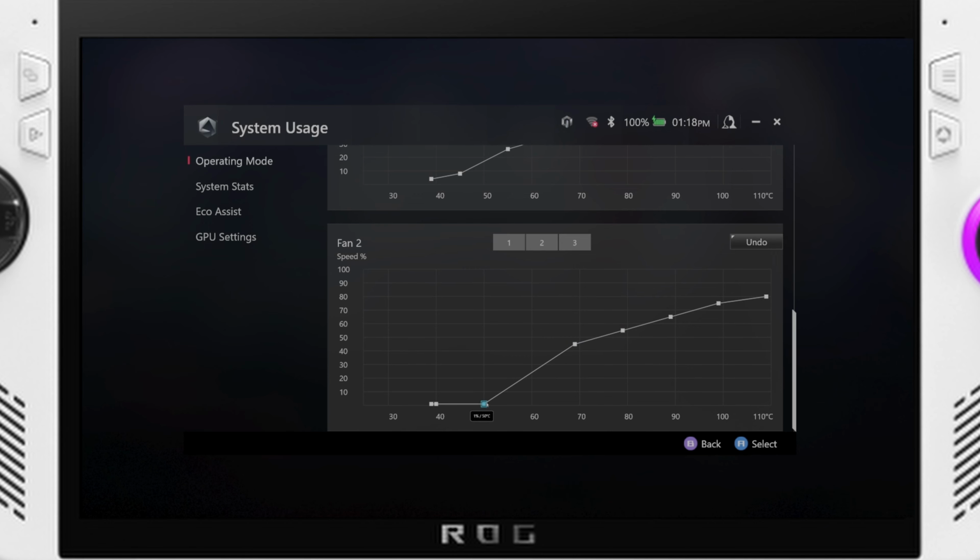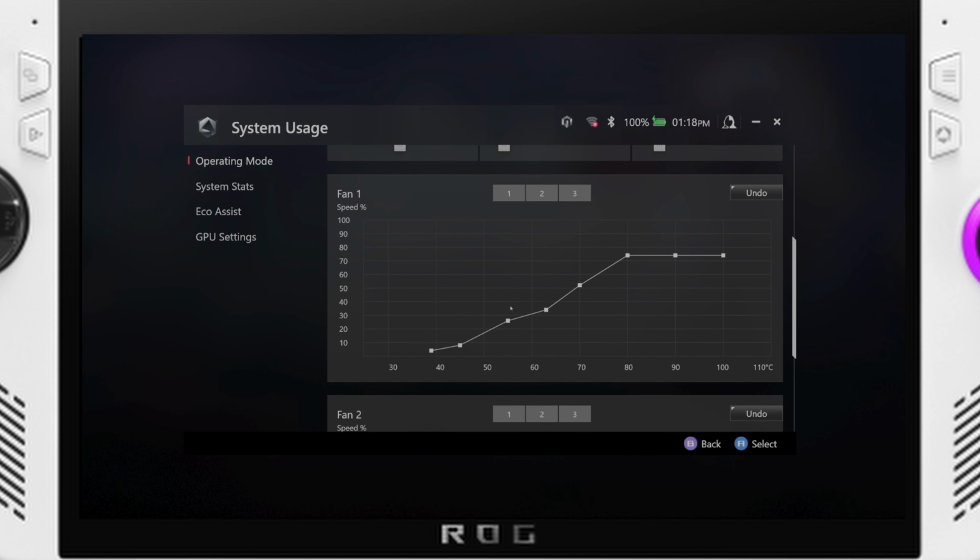There is plenty of fan speed and enough heat dissipation here to dispel all the heat that they need to. But by hard locking it in the software, and I believe even the BIOS, it has a lock too. When it gets to about 70 degrees is when it wants to kick up the fans. But again, you'll see that with fan 2, you can at least set more of a stepping curve from the fourth dot, where it starts at 45%. And then the first three dots, you can set those as low as 0 if you want.